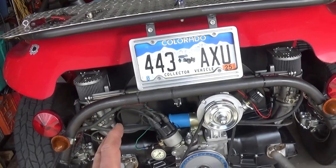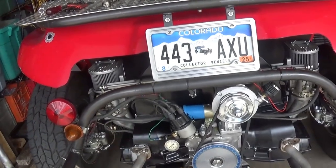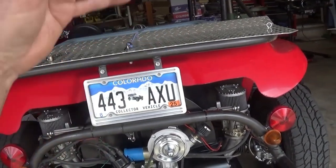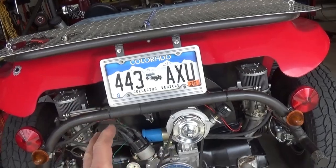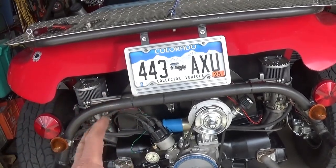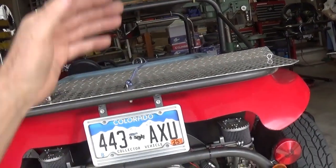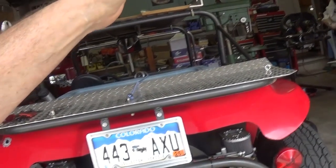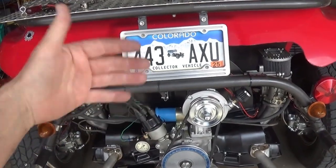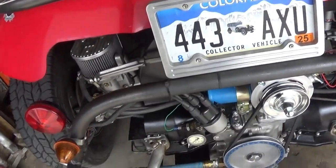If you watch any video stuff on YouTube, Engine Masters with Motor Trend, I love watching those dyno runs and stuff because they have the graphs and they can show where's the torque, where's the peak horsepower. It's always all the improvements that they make, turbocharging, supercharging, multi-carburetors, changing manifolds and camshafts. What it does is it allows it to get more RPM and you get higher horsepower, but it's all up high. If you're going for maximum, if you want a 700 horsepower engine, it might not run the way you want going from stoplight to stoplight, especially if it's a standard transmission and you got a heavy enough clutch to hold that kind of power.